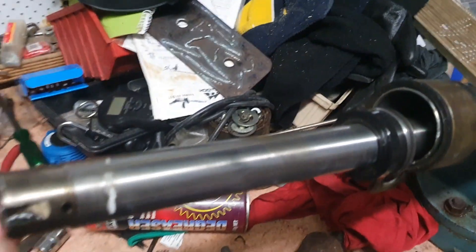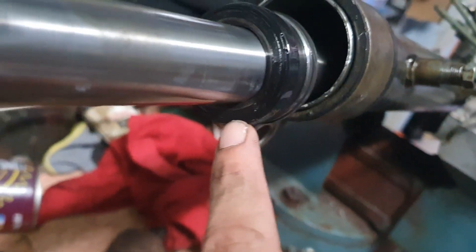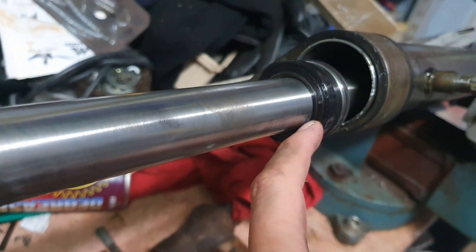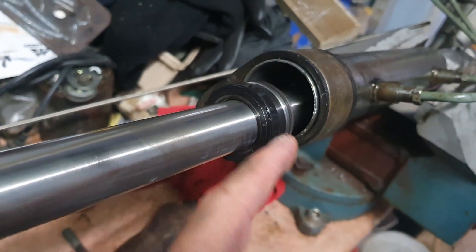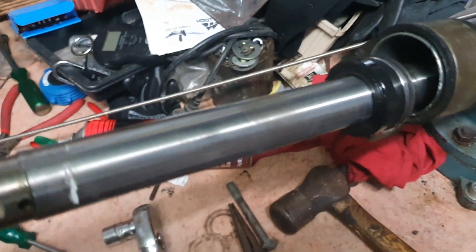So this shaft is now out of the rack. I struggled to get this out even with the pinion out. The culprit was this oil seal, and what I did is I got a screwdriver, I punctured it, warped it slightly. When I was hitting it the screwdriver was actually sliding backwards. I tried to warp it as much as I can, slid it back, and then pulled it the opposite way. After I warped it, it was loose and voila — it's out.